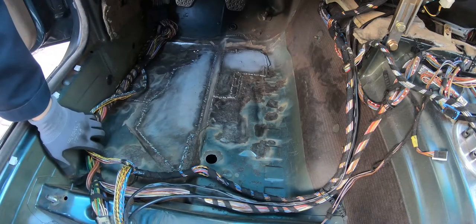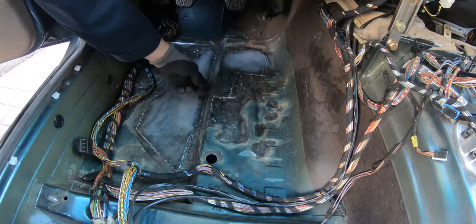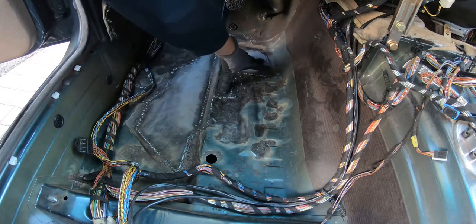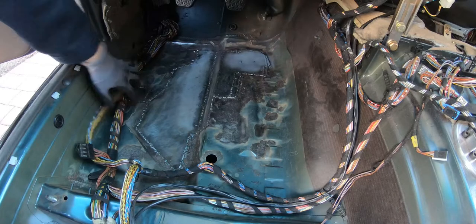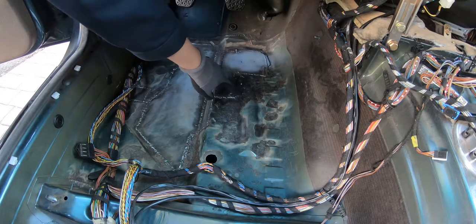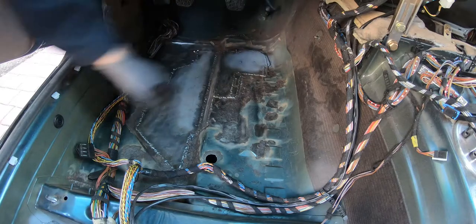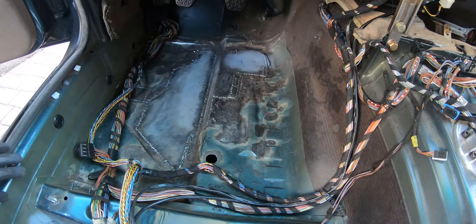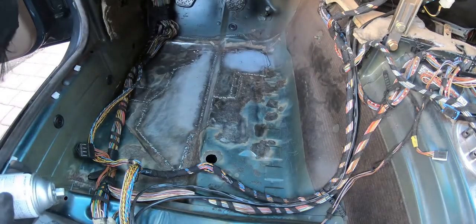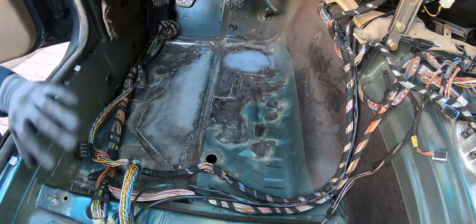So I'm done with the welding. As you can see, originally I had it all in one piece, but there's this curved part that made it pretty hard to weld in one piece, so I cut it into three pieces — plus another tiny little square piece right here. All the welding is done, and there are still some small tiny holes where the rust ate all the way through, but these are really small. It's fine to leave them because these small holes would take too much time to weld, and I need to finish up soon since my classes are starting. I'll just leave them — I'm going to cover my welds with seam sealer anyways.